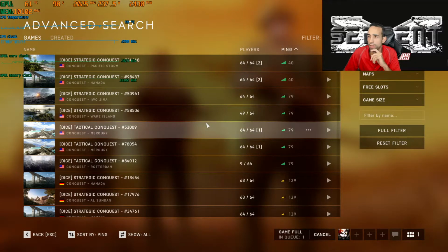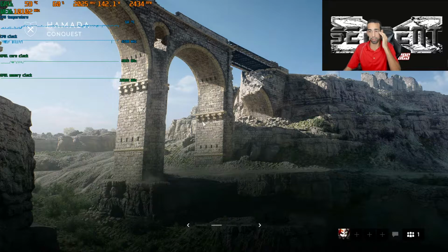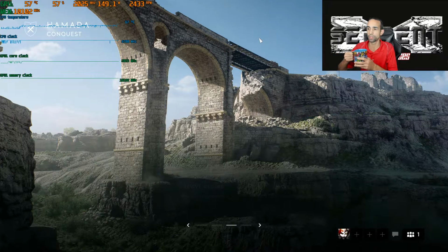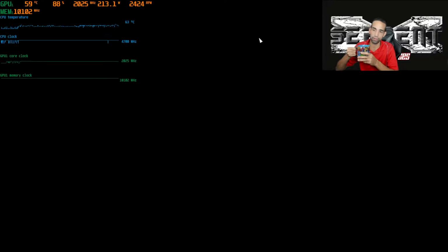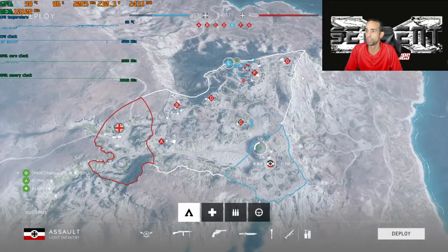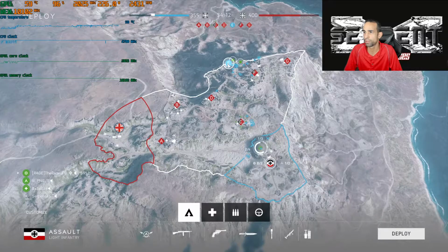No, the only throttling we had so far was due to memory clocks. The memory temperature is getting too hot. Jedi, I mean, there's a power limit, but if you want to share some more details of what you mean by throttling of power. Yet, the only throttling we saw was really during the last stream, where we were hitting memory temperature constraints, which brought the core down. I was saying it wasn't thermal throttling because the GPU temperatures were fine, but it wasn't the GPU temperatures, it was the memory temperatures, as two gentlemen in the comments pointed out.